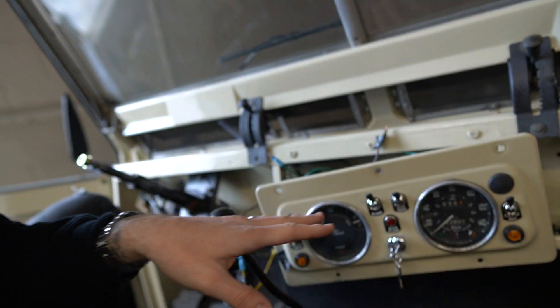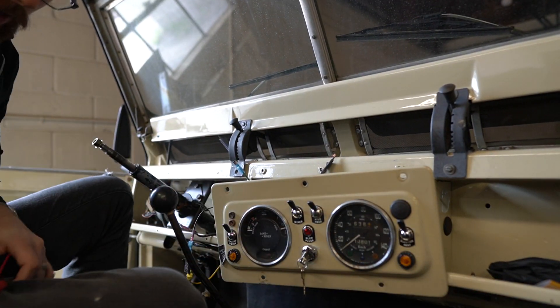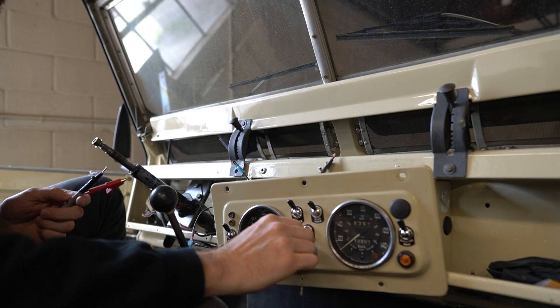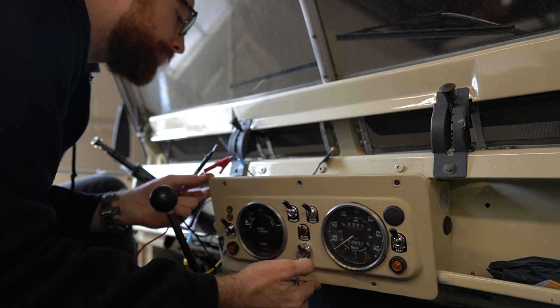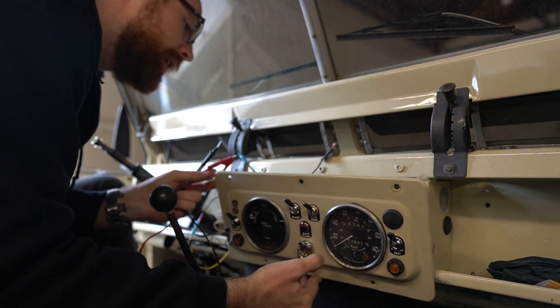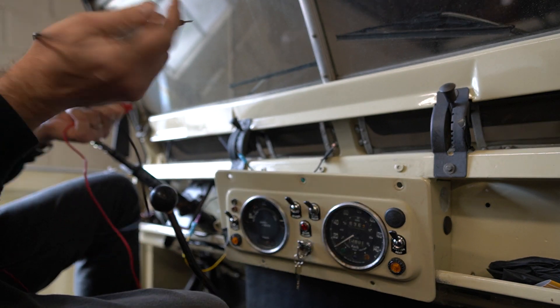If I go up to the dashboard on this car, I can connect this to the battery lead. So this is the dashboard — obviously it's a little bit of a work in progress. The ignition has a hot line that comes straight off the battery that's always hot. So if I want to figure out which one is hot, what I can do is I can ground this.